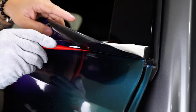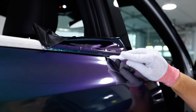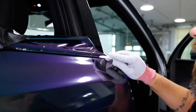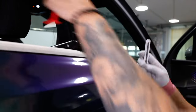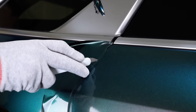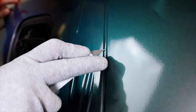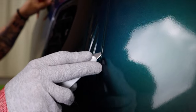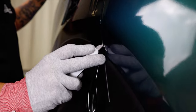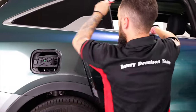Now move to the top molding — here it's tucked in just like at the bottom and cut safely away with a sharp light touch. Once the excess film has been removed from the top, always come in and seal the deal. Then move on to the outside edge where it meets the back fender — cut on the back fender side, which gives about a quarter inch of extra material that can be wrapped around the edge for extra coverage and long-term durability.